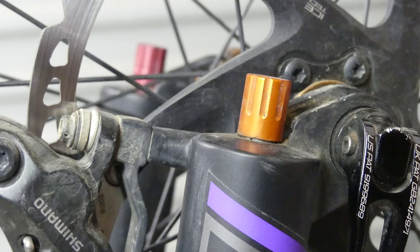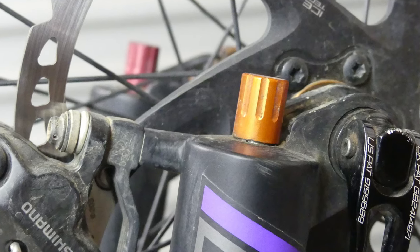On the Ribbon Air there's the ramp control cartridge — the same one you can buy aftermarket from MRP for forks like the 36. It replaces the need for volume spacers: rather than being position-sensitive, the ramp control cartridge adjusts progressivity in a speed-sensitive manner, and you can adjust it on the fly at the top of the fork. The coil version retains a form of ramp control, moved to the bottom of the fork, and it still behaves in a speed-sensitive manner.